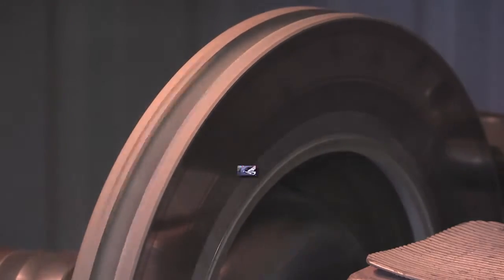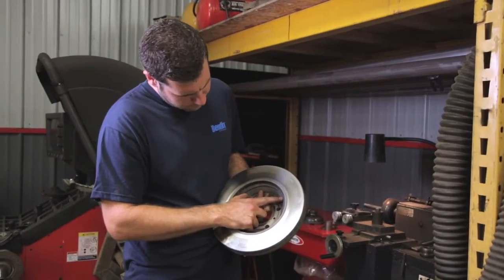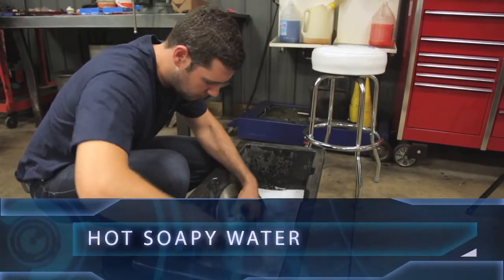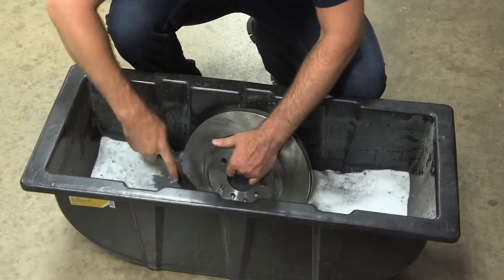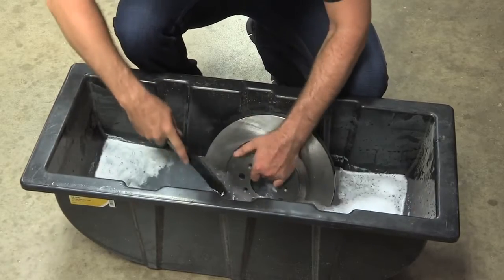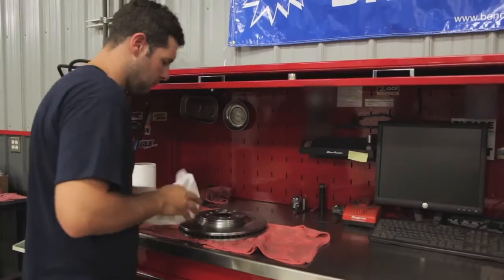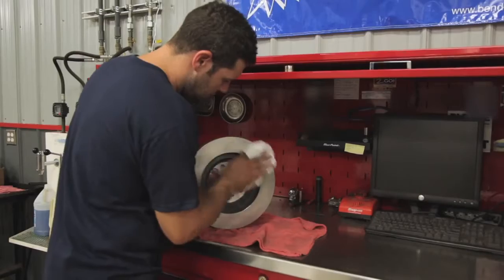When you are finished machining, a ball hone or other sanding device should be used to put a non-directional finish on the rotor. With a smooth and finished rotor, it is now time for cleaning. The cleaning process should be thorough to prevent corrosion or rust, which could compromise the braking system. To clean new or freshly machined rotors, use hot, soapy water and scrub with a stiff, non-metallic brush. This method will deionize and lift away trapped particles that could cause brake noise or more severe problems in the future. This method is actually better than using a chemical brake cleaner, which most often is petroleum-based and has been known to trap metal particles in the friction surface.